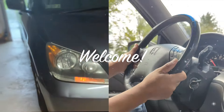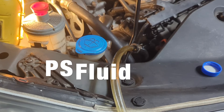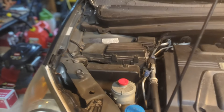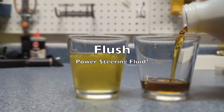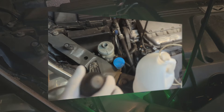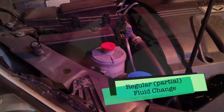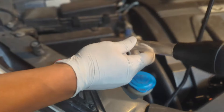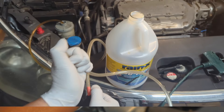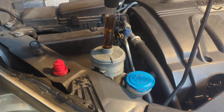Welcome to Professor's Garage. Today we are diving into the world of power steering fluid replacement. In my previous video, we discussed the basic method to maintain power steering fluid — just suck out some of the old fluid with a turkey baster or a syringe and top it off with new. If you do this regularly, your power steering fluid will stay well lubricated and happy.